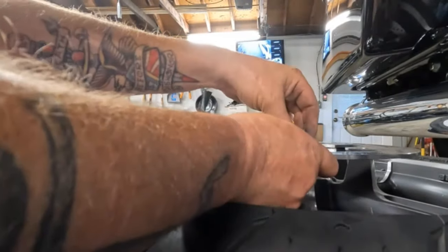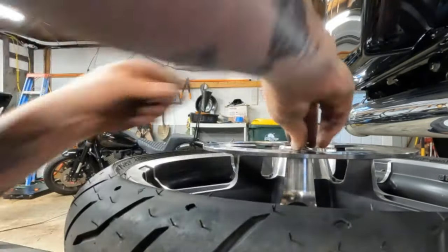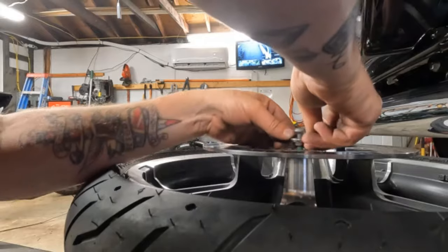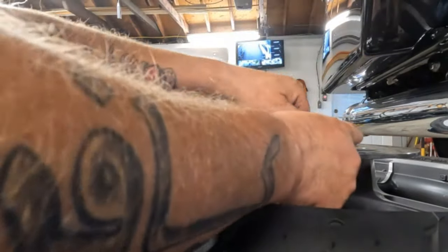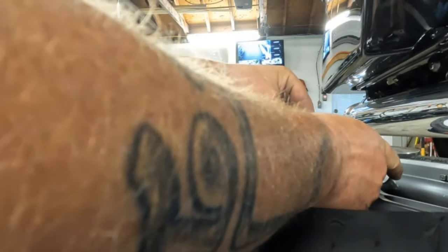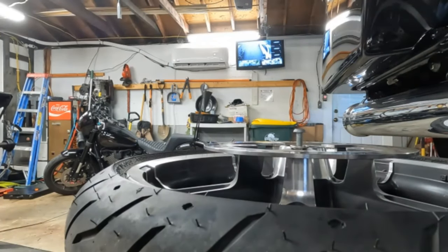And well, what you wanna do is line this stuff up so the hat sits inside and you're not crushing the spring washer. That's kind of important when you set this up. Take the bolt out of this. It might be a little bit easier. There we go. So yeah, sometimes you could just get them right in. Sometimes you just gotta remove the bolt to let the hat sit down the way it's supposed to.